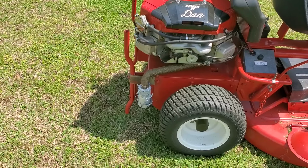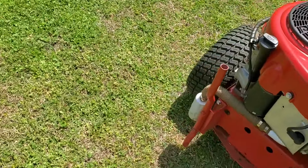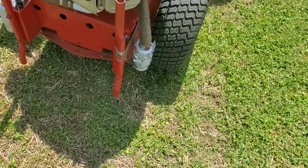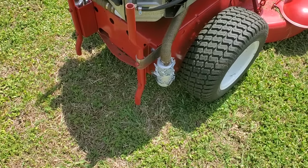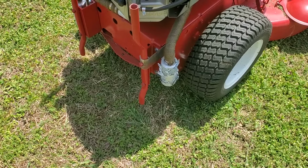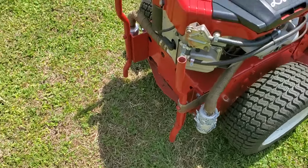Man, that paint didn't last long, did it? That's VHT high. Okay, this one did. So that tells me that apparently my prep work is not very good on that. I finished off with vinegar. So I don't know. Anyway, I'll take that off and repaint it.